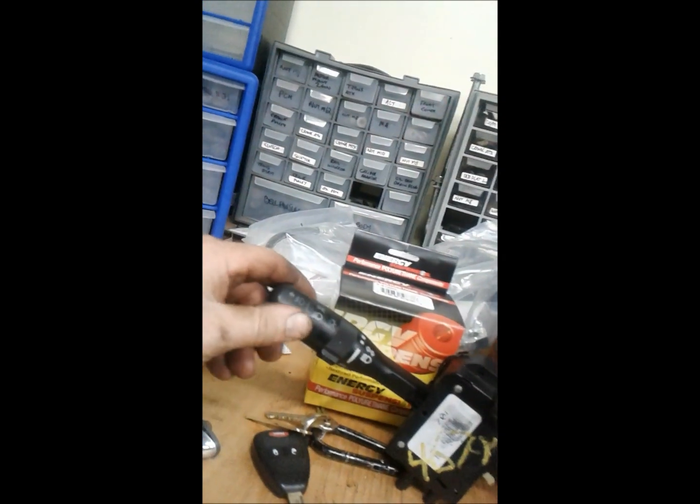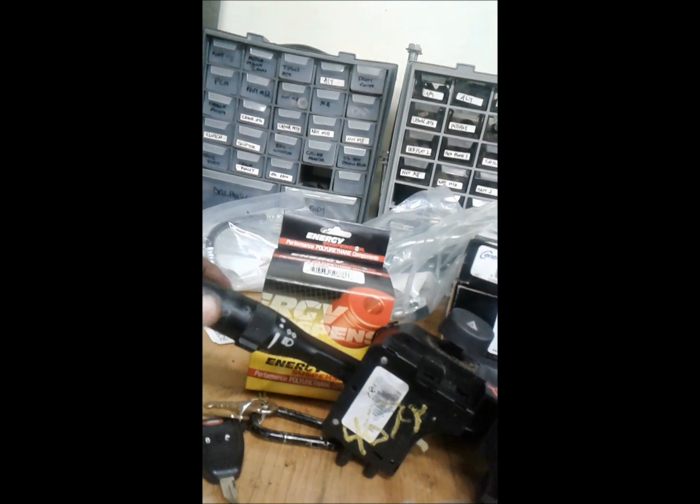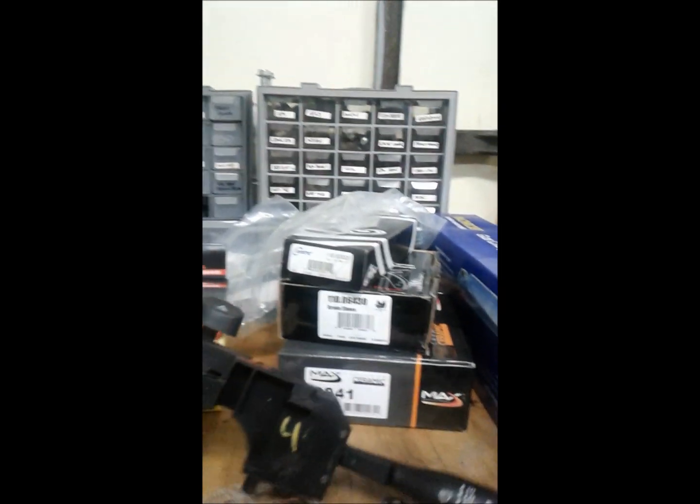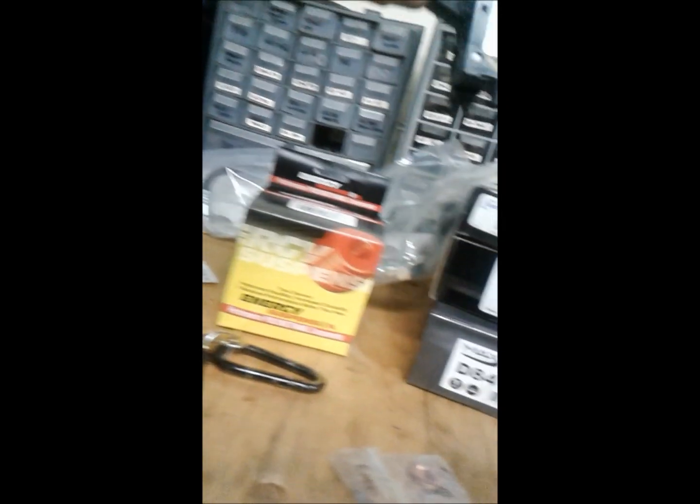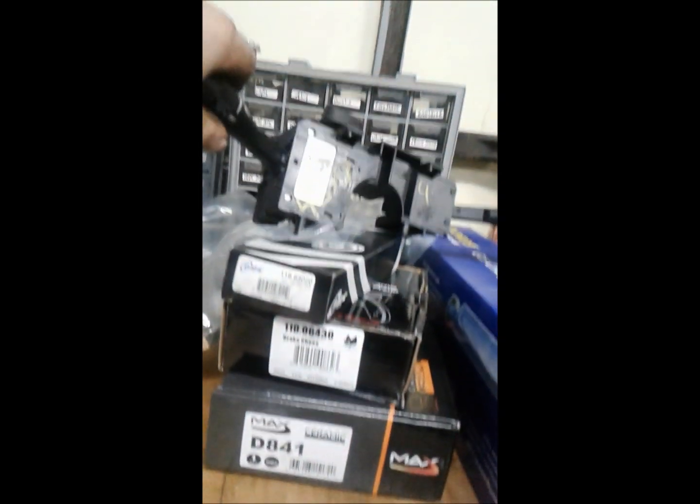And we have a problem. The fog lights will not turn off. So, as usual, blame the multifunction switch. It's the Achilles heel on these little cars. So, we got this one from the wreckers. And judging by the marks on it, someone before me got it from the wreckers too. So, we'll take that as meaning it's a good one. We'll find out.